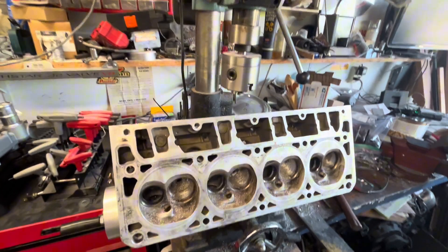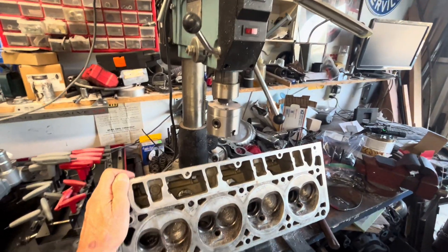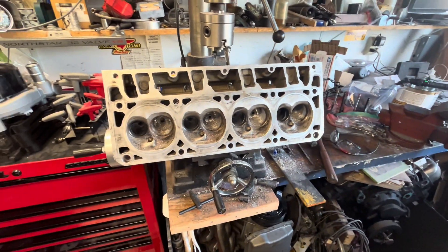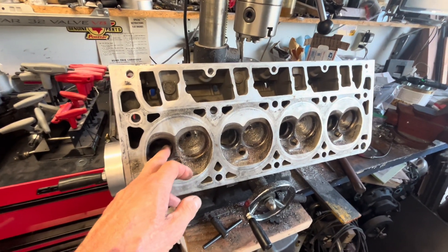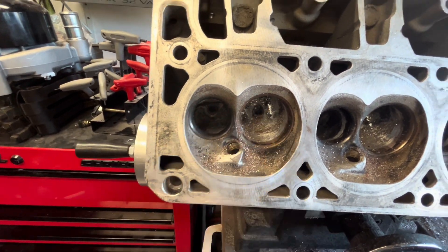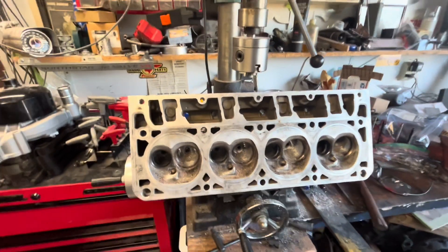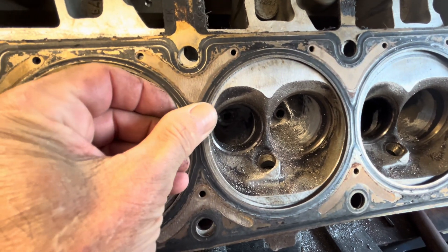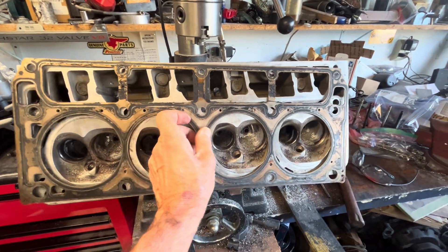Hello everybody, here is a little video. This is an LS head — I bolted this thing to an XY table to do some of the port work. I still use bits in a drill and did a lot of it the old-fashioned way, but I think it's really cool. When you grind one side and try to do the other it skips over, but with this method you have a little bit more control. I'm also going to relieve the area next to the valves with this — I don't feel comfortable doing it by hand. I'll show a little video of how I did that, so stay tuned.